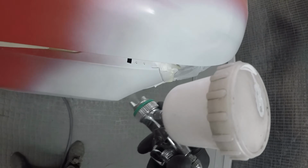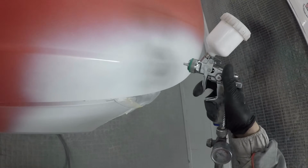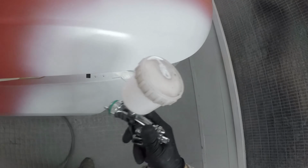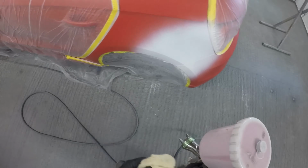this. And this is one of the reasons for using the ground coat, because we don't want to put too much pearl on and start overcoating and changing the colour of the panels. We just want to match this colour in, so we have to use this white ground coat to ensure that we're not going to put too much pearl down.